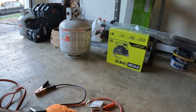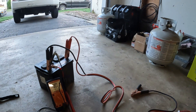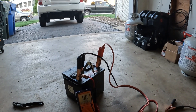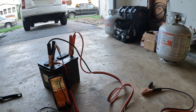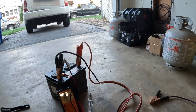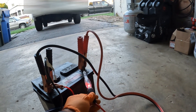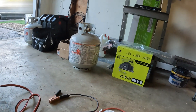If the starter is on the car and you have room to access it but don't want to pull it out, here's how you test it. Hook your test lead up to battery negative or any good ground. To verify your test lead, hook it up to a ground and touch something that has 12-volt power, like the battery if you can get to it. If it lights, your ground is good and you can begin your test.